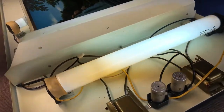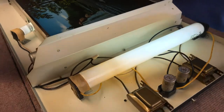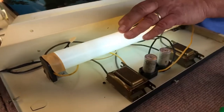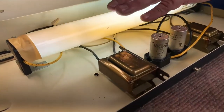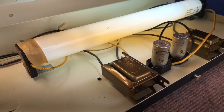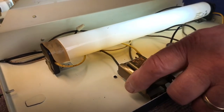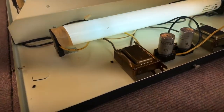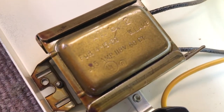Steve, would you tell us about a recent customer that had to replace four bulbs in a Scenorama? Well, actually it's five. What happened is — and you'll notice if you have one bulb that's out, obviously try the bulb and starter first — but if the bulb immediately lights up briefly and then goes, you have a bad ballast. I had a customer that went through five bulbs before he brought it to me.